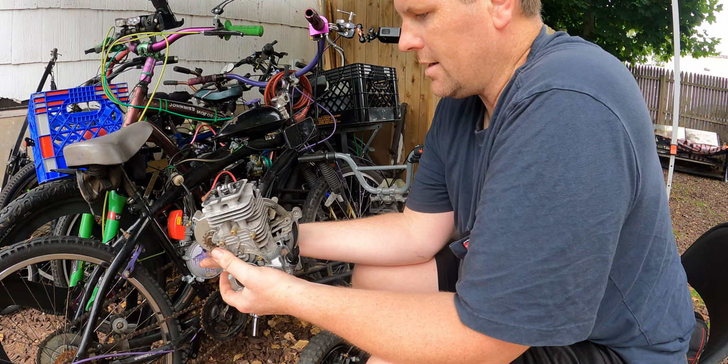It was weird. Only fix was to drill and tap. I don't have heli-coils for that size. Since I was doing the one side, I'm like, whatever, just do the other side so it doesn't look stupid. It looks symmetrical. Took the acorn nuts off because those were stripping out immediately. And did the preload on the clutch, so we're good there. The spring is on too, the way I like to put it, hooked into the actual eyelet. Everything's good. Cut the white wire off before. Got all the mounting hardware on.